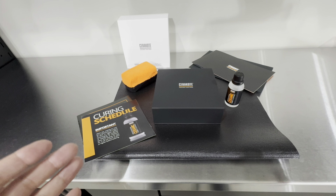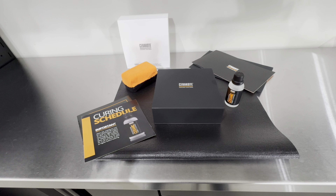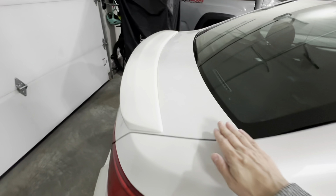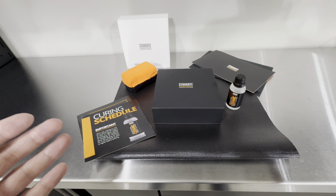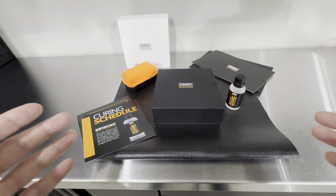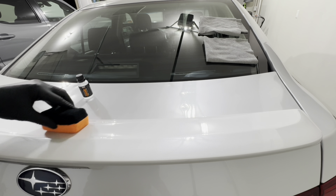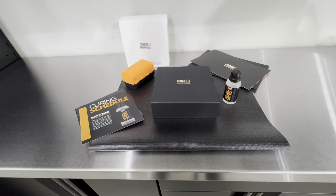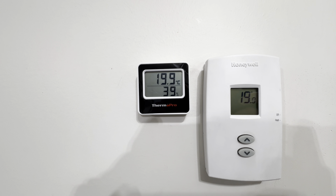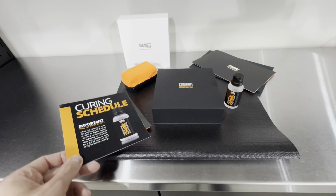We're going to be installing this coating on my 2010 Subaru Legacy, which has never seen a ceramic coating — pretty much virgin paint. We'll apply it to the passenger front door, a vertical panel, and to the rear trunk, a horizontal panel, to observe behavior on both surfaces over time. I'll only coat the right side of the trunk and leave the left side polished only, so we can detect differences down the road. We're working in my garage at 19–20°C and 39% humidity, which is in compliance with their curing requirements.